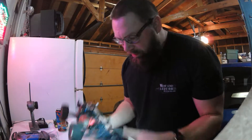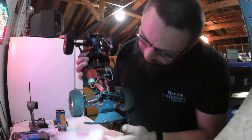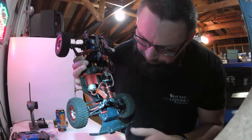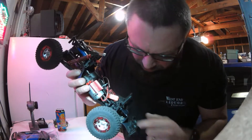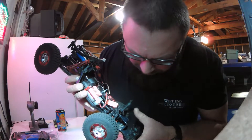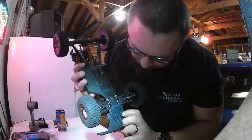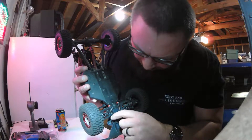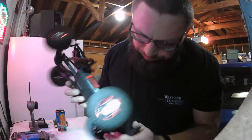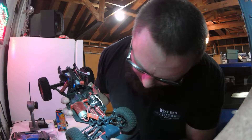So what I did is I measured, I set the bumper up front — how far do I need to be away from the tires? I kind of roughly guesstimated how far I needed this plate I made to be. So at about an inch I bent it up, about an inch I bent it back. Just experimented with the angles. Drilled the holes, took my Dremel and cut there so it wouldn't interfere with the suspension. Same up top so it wouldn't interfere with the suspension.